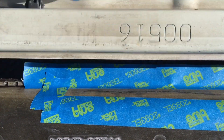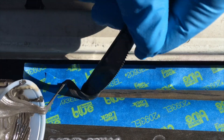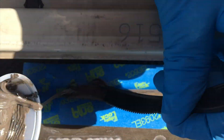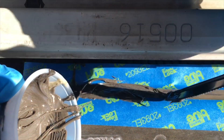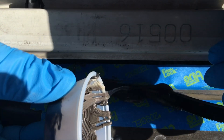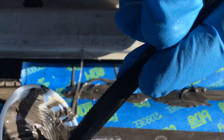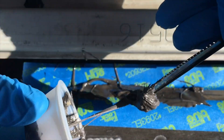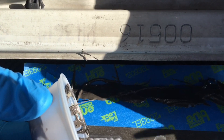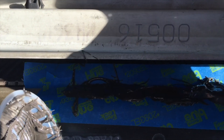As you can see, I already got it taped up and you can see the size that I'm going to patch. I'm just going to apply that liberally. And it looks like, just by dumb luck, it's going to come out the same color as the radiator — that really wasn't a plan. Being that that radiator is just plastic, and like I said, this is just a temporary fix. Make sure it's evenly covered on the way across.